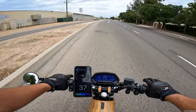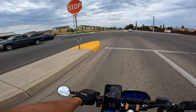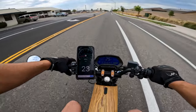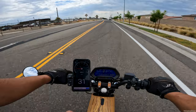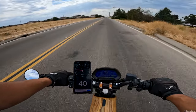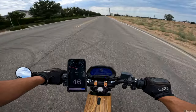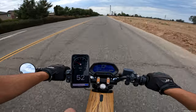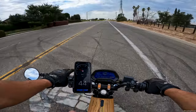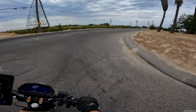Let me see what kind of voltage sag I get. We got about 78.4 volts under full throttle — not bad compared to what it used to be. The bike isn't on John Angel's sicko mode or anything like that; I believe it's on torque mode, one above stock settings. Acceleration time is set to four instead of five. Actually, I think power and battery are at 65%. After a full pull we dropped to 77 volts, but we are hitting a higher top speed — 53 miles per hour, which is insane.